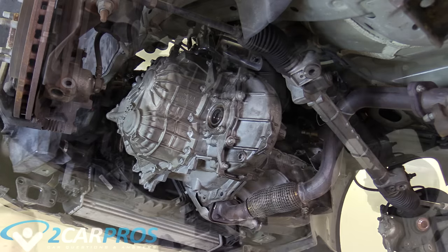The next thing we need to do is replace the starter. Ours had a ground on there so we've got to replace that as well. We're going to tighten those up — make sure you tighten the top one and the bottom one similarly so it's not on crooked when you're tightening it. Once both of them are tight, we can replace this ground. If you leave that ground off, all kinds of odd things can happen electrically in the car, so it's important to put it on.